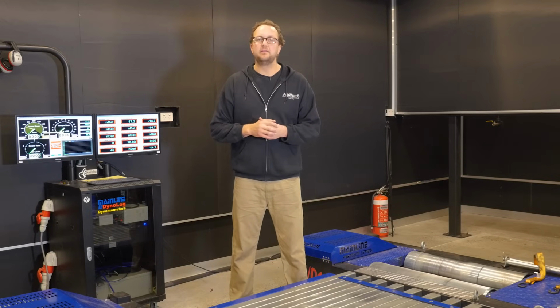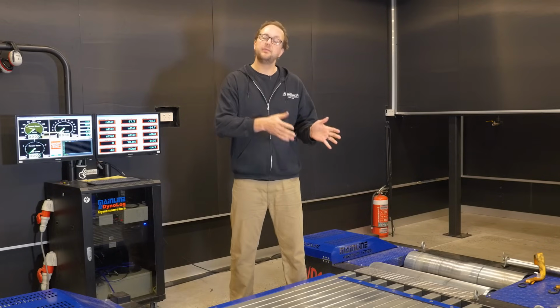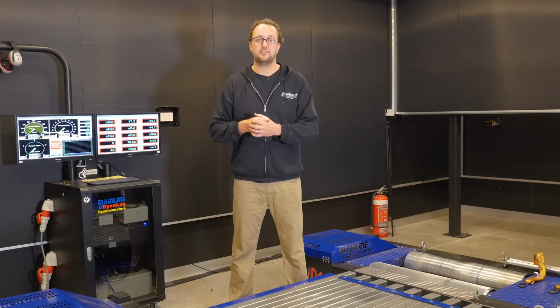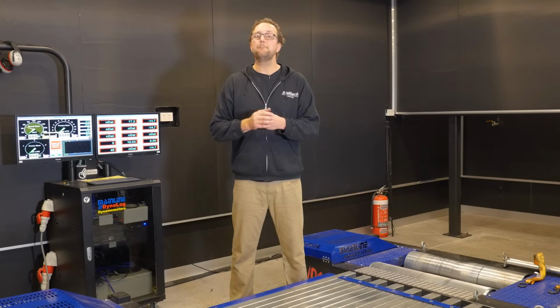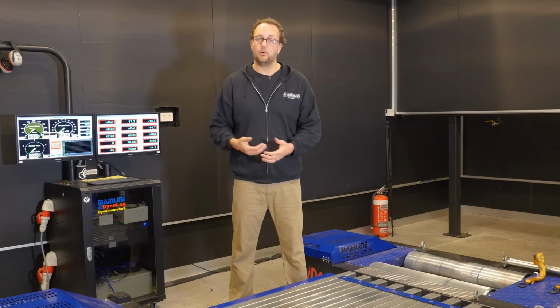It also means I can do a ramp test, allowing the engine to go from 2000 RPM to 7000 RPM over, say, 15 seconds, essentially choosing how many meters or feet per second the dyno will allow the engine to accelerate at. This is known as a power run.